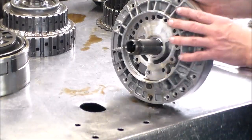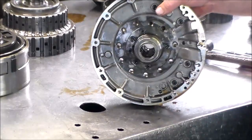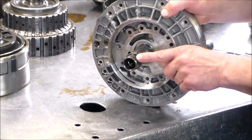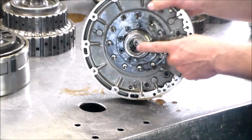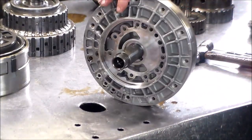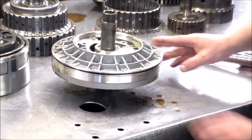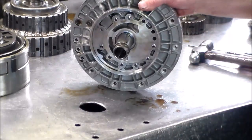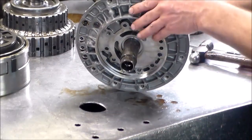But I didn't really need the body and gear, so what I actually did was I just unbolted the stator and used my stator. But you have to watch this too, very important. For some reason, they don't ask you what the measurement of this is, they just ask you for the inside diameter of the rear stator bushing. All right, so again, if you buy anything used, just put it side by side, match it up, and make sure it is correct. So that's what you gotta watch out for when you're dealing with the cars with the larger engines.